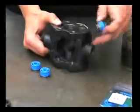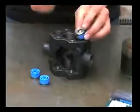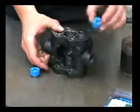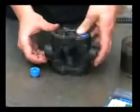Remember that orientation: on the outlet port that valve will face with the seat up; on the inlet side that valve will have the cage facing up. Flip the pump over, put some oil on your o-rings — inlet port cage faces up, outlet port the seat faces up.